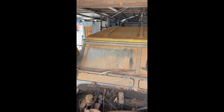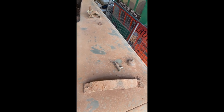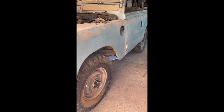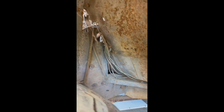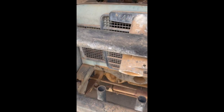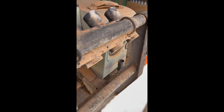The windscreens are pretty dirty. This one had a shovel holder on the wing. The colour looks like it was originally that light blue — I don't think this is green that's faded, I think it was light blue. Military style tyres. The wiring is a little bit dodgy; some extra wiring has been put on, not sheathed properly, and unfortunately the vehicle was used on the beach. There's still some mud under the wheel arches from where it was last off-roaded. On the front here we've already spotted a fair amount of rot, which is not good, and even the bull bar is moving considerably, so the dumb irons are pretty scrap.